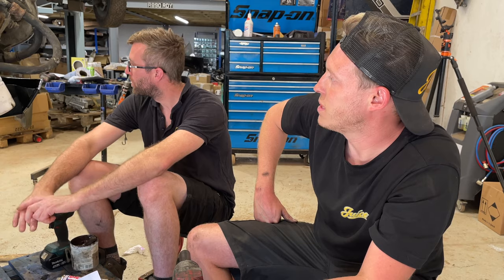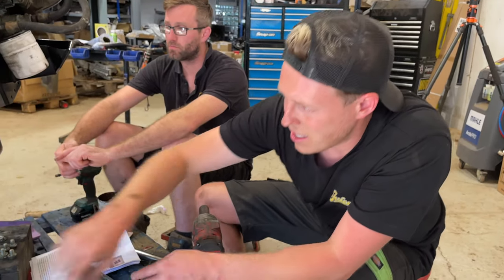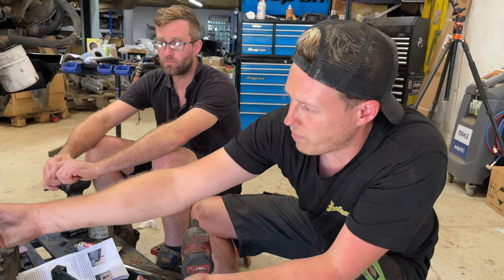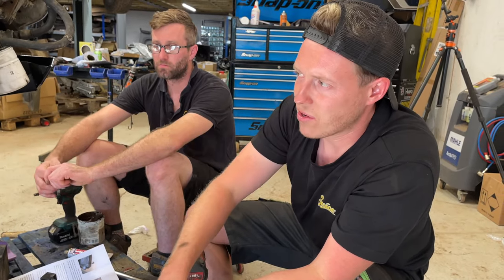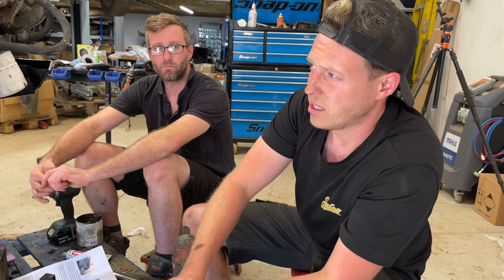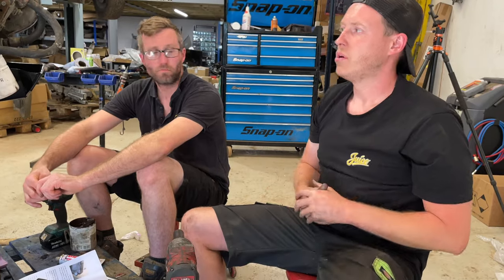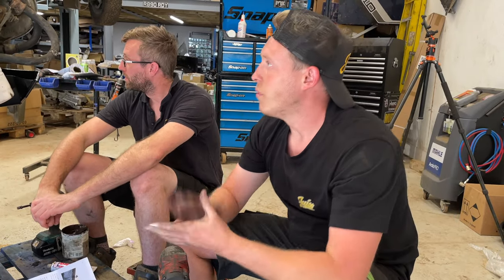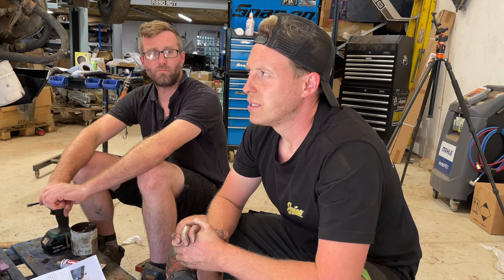That'd be nice. It will be nice, yeah. It'd be nice to see it mounted up to an LT77. Not that many modifications, you know. We've got to drill out and re-tap one of the lower holes on here. We've got to grind a part of the lower housing off to clear the slave. Take two threaded studs out because they won't fit, and then it just clicks straight together. And remove one of the dowels. And then, yeah, it just goes straight in. So, pretty cool overall. We've made some good progress, and we'll see you guys in the morning.